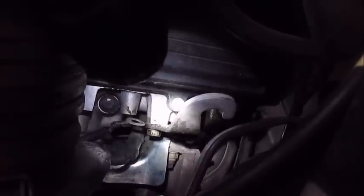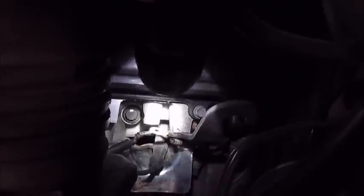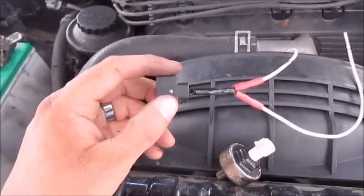I've had it on here for about three months now and have not had the check engine light come on at all, and it's been running great. For the tap, the knock sensor has some tapered threads and I didn't have the right tap, so I just found something that was close — it worked and tightened up. The other thing you have to do is ground the sensor; right next to it you can see this eyelet, the ground eyelet.